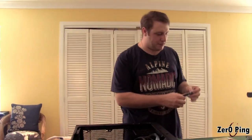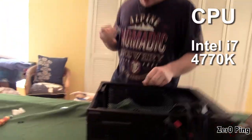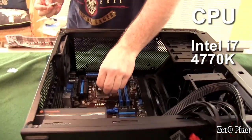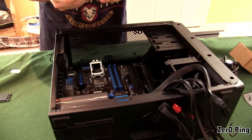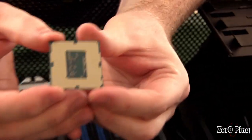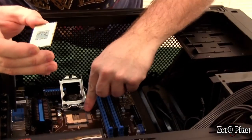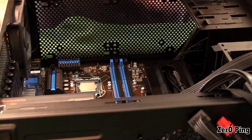The next step is deciding what you want to install next — there's no set path. As long as you don't have any power going through the system, you can't do too much wrong. Let's start by installing the CPU. We're popping an i7 in here, because why wouldn't you? The number one thing you can get wrong when installing a CPU is ignoring the pins. There's a set pattern you need to follow — if you install it wrong, you're going to break something very important. Generally there are two little notches that'll help guide you in. If you can't line up with the notches, don't put the lid down, because it's going to push all the pins in or break everything.